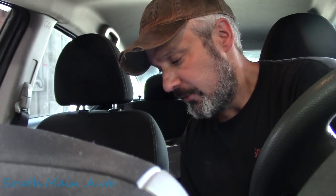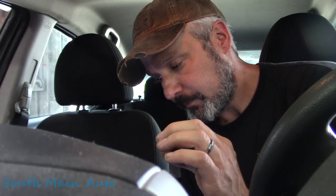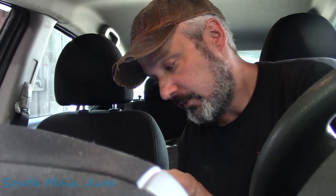I like it for situations like this, where something like this isn't in service data and you probably wouldn't have checked it. You might get to it eventually, but you're going to be a few hours into it. There are other situations where you've got a circuit code, you've got power at the fuse but no power at whatever component. Before you look up the diagram, you go on Identifix and check for a common break spot - people log where they found broken wires, like by a door hinge. That can be very helpful when you've identified a broken wire and someone's already found the exact location.